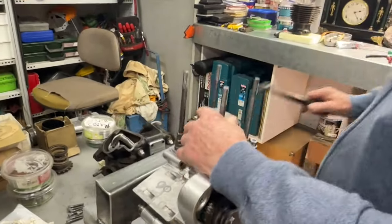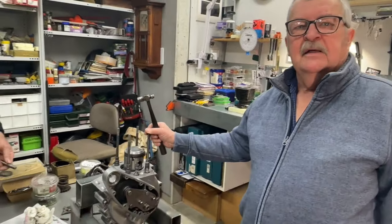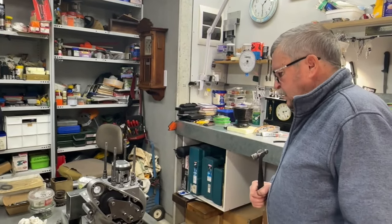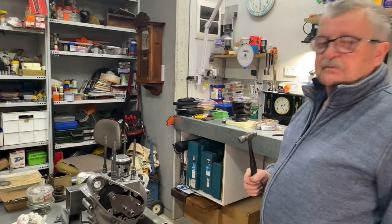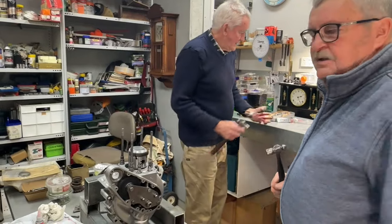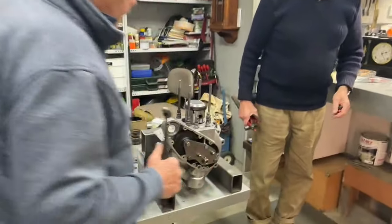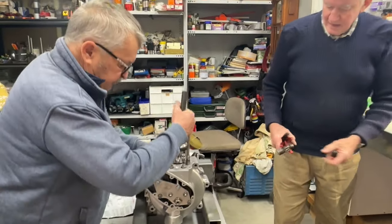Do you want to tell us what sort of piston this is? Right, this is a piston out of a 750 Triumph Twin, 74 mil. B31 pistons are a bit hard to find, but these Triumph pistons are good quality pistons. And you can bore them to a reasonably good tolerance, and it gives you a few more CCs as well. Yeah, okay. And there's plenty of meat in the B31 barrel to bore them at. So what are you thinking to be out to now? 375. Okay. The stroke's the same? Stroke's the same. Yeah. So what we're going to do is just get that a bit further.